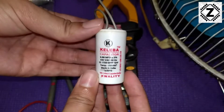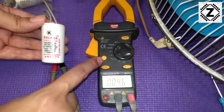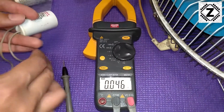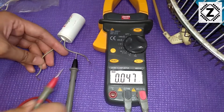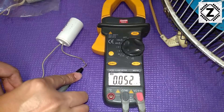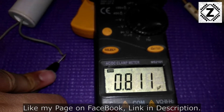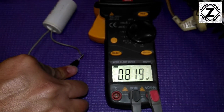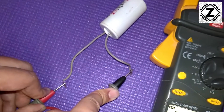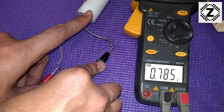Here is the capacitor we were talking about. Let's test it using this multimeter — the facility to test capacitors is available on good branded multimeters, and buying links will be in the description below. Let's use the probe and take a reading. You can connect it either way because these AC capacitors don't have polarity. One golden tip: I'm not touching any of the wires because the human body has a bit of capacitance and if I touch these wires, the reading will change. The advertised value is 2.5 UF, but what we see is 0.8 UF — this shows the capacitor has become weak and should be replaced. This capacitor is toast.